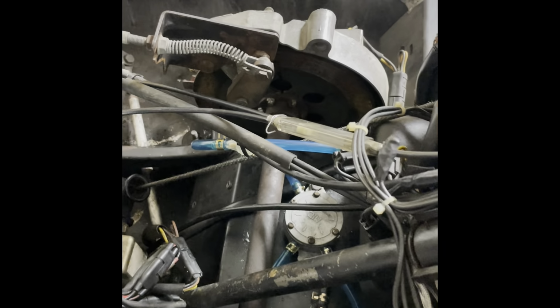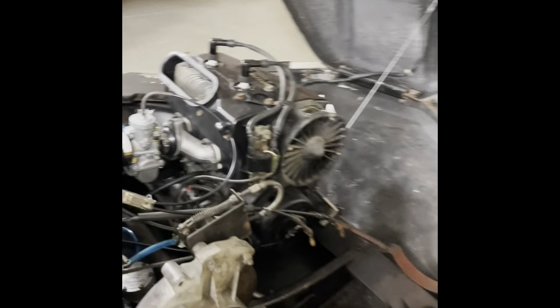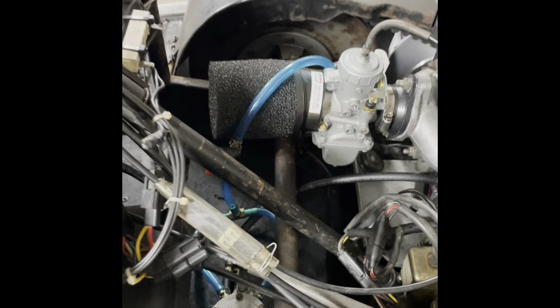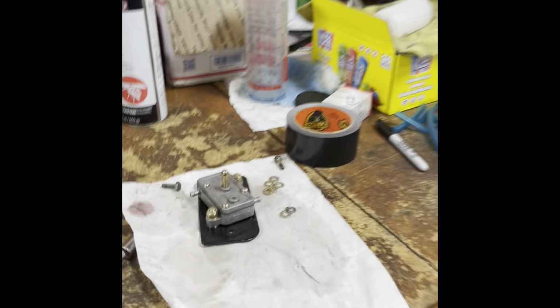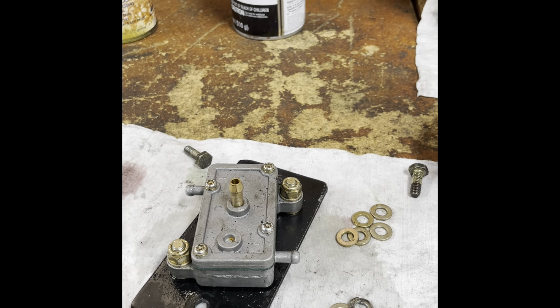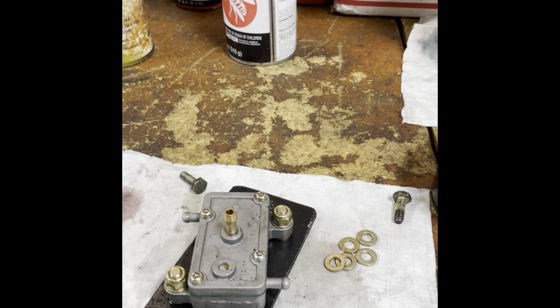Not a lot, but got that fuel pump swapped around. Got the shut off there. Got the filter there. Kind of got it tied off there so it doesn't rub on the pull cord. But I'm gonna go check the mailbox for this O-ring for this bottom sprocket. Hopefully that fuel pump works out better than that eBay one. It seemed like it was leaking from the body. It was kind of weird. I'm pretty sure I tightened these screws on the top too with no luck. So yeah, I may disassemble that later to see what I got going on. But for right now, the old pump's got a rebuild kit in it. So I'm gonna run that. That's it for today. Off to work.